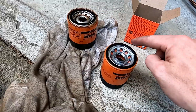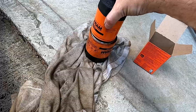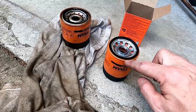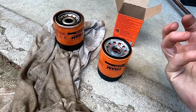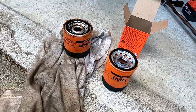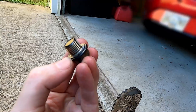In case you're wondering about Fram filters — I wouldn't put one on my Miata, but a 200,000-mile Eclipse? A filter is fine. Before you put the new filter on, be sure to put oil around the gasket. You can use old oil — it's not going into your engine, it's simply lubing the rubber gasket material so it doesn't bind when you're putting it on.